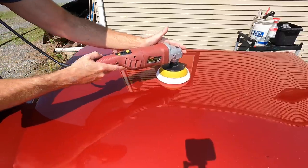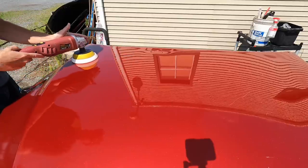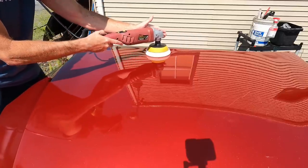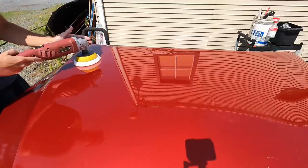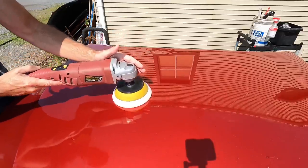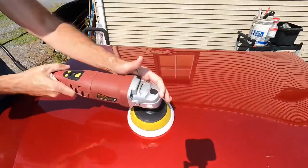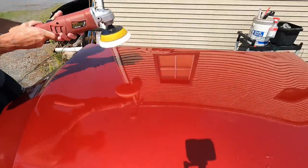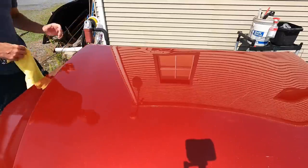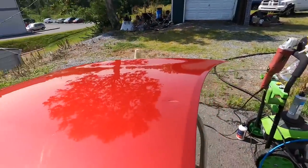What I choose for correction here — the Pop-A-Cut and then the Fabulous Finish — is done for a reason. Again, you can see I'm not rushing, and I'm still doing a rather large area in direct sunlight on a very warm day. Not worried whatsoever about the polish drying out. The cycle time, the open time on these — just what I'm looking for. I always let the polisher come to rest before lifting it from the surface, and that doesn't matter if it's a rotary or dual action polisher — it will be easier for your polisher, the backing plate, the gears, and the pads if you do so.